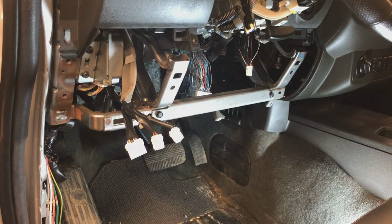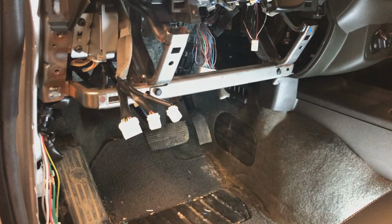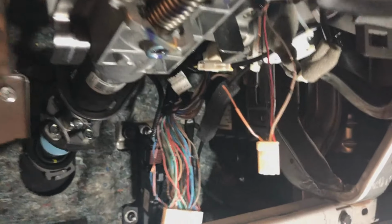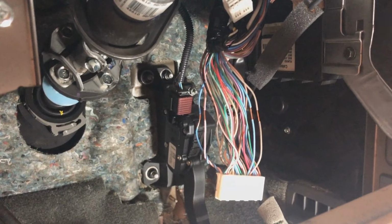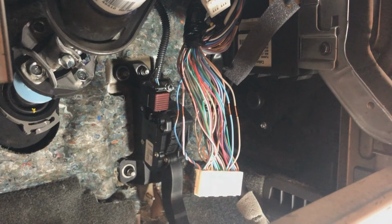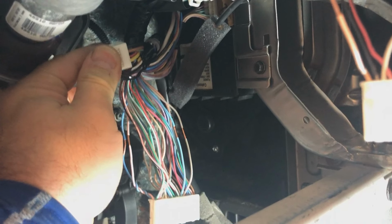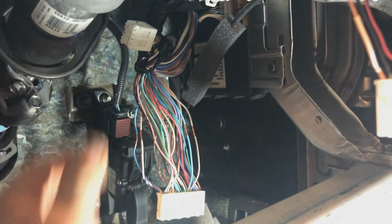into the vehicle. So this is what the dash looks like after everything's been uncovered. We've got the ignition harness, bottom left-hand corner there. That's the ignition harness. Yes, it is in the driver's kick panel. Here's our NATS connector where we do our security connections. And then over at the back there, that's the main BCM connector where we get keyless entry, CAN high and low, auto lights shut off. And then somewhere up here, we will get park lights and brake, which I haven't done yet. So I'll do that first, and then I'll show you what this looks like after everything's installed.